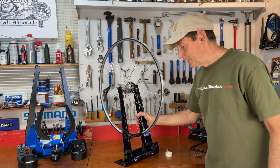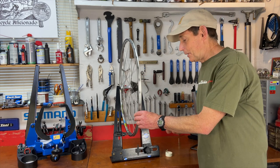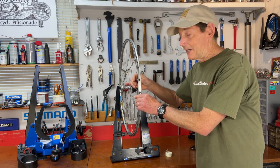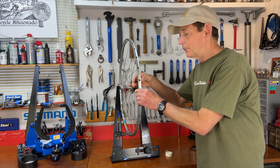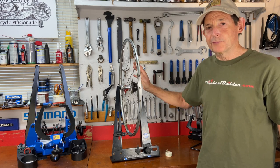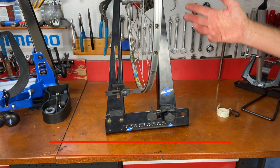The truing stand also works great as a wheel holder when all the spokes are loose — like when you've just laced up a new wheel. You can go around the wheel starting at the valve stem and tighten each spoke an even amount to gradually bring the tension up all the way around. You do this most when building a brand new wheel, to get all spokes to a low but even tension before you start truing.